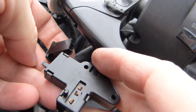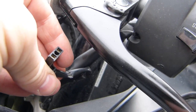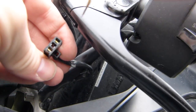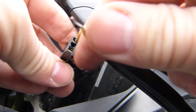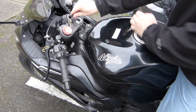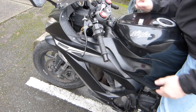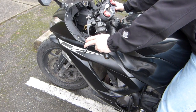Because this unit is faulty, what you can do if you have the same situation — unable to start the motorcycle in gear with the kickstand up, ignition on, and clutch lever pulled — is jump the clutch switch with a single piece of wire, just like so. It's very ugly, but that's why I chose yellow.